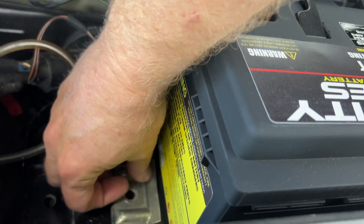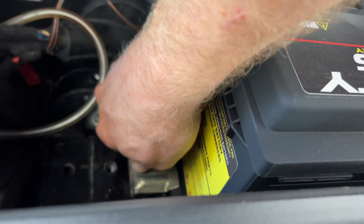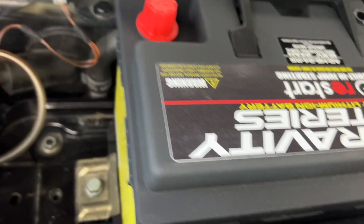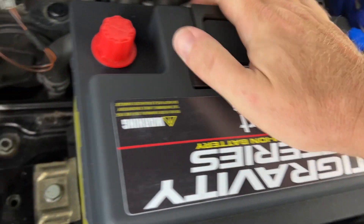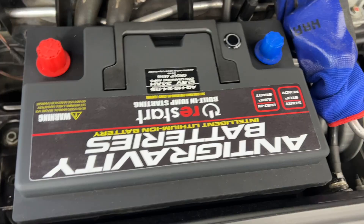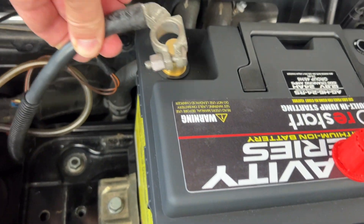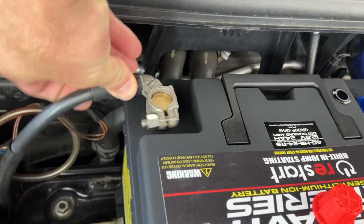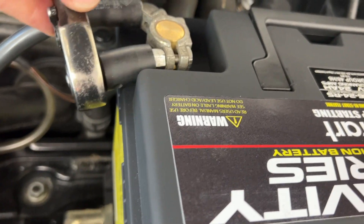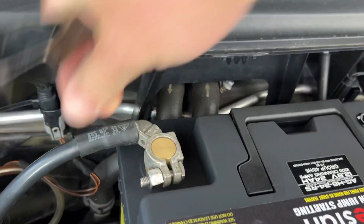Put the plate down there, stick the old bolt back in, and get it started by hand. It is cranked down — once it is cranked down, that battery is not moving anywhere. I had to go really tight on this bolt to get the plate not to jiggle at all. Now pop these off and replace the terminals — you always want to put the positive one on first. Make sure it's nice and seated; don't have to go crazy, just nice and snug so you can pull on it and it won't move at all.